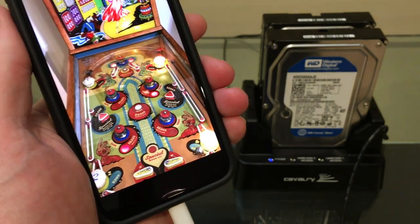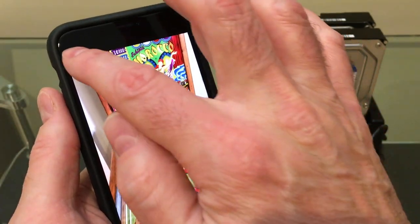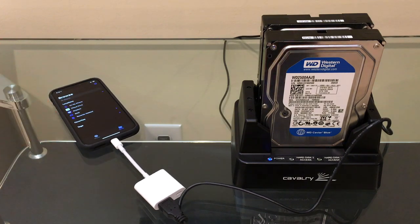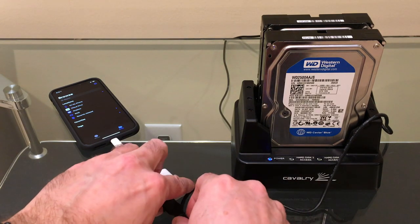Okay, so how do we know it's actually on both drives? Well, we can test that too. I can switch this array back into JBOD mode, and we can look at each drive separately to confirm that that movie file is in fact on both hard drives. So we'll disconnect here,